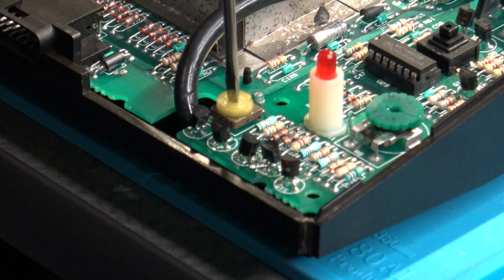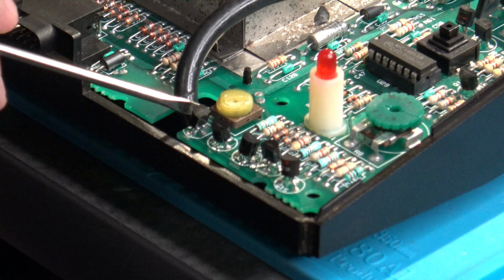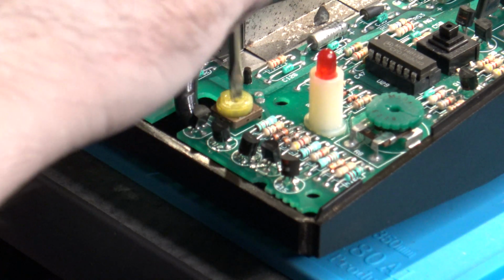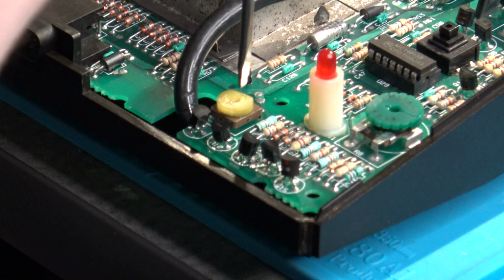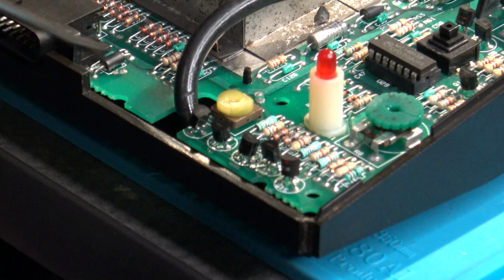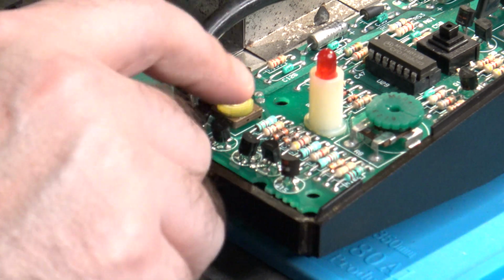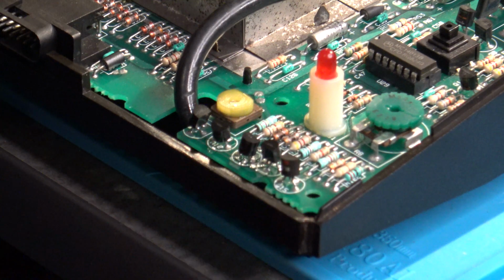And then I would just go ahead, and you'll notice when you're turning this that it will basically turn about 3/4 in either direction. Basically, it'll go from this corner of the trimmer to this corner of the trimmer. So to get a baseline, I would just start with the trimmer right at the halfway position. I can almost guarantee you this isn't going to be set right from the get-go, but it's a good starting point to work from. What do we do from here?